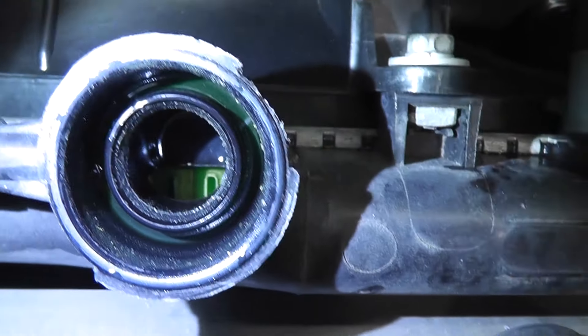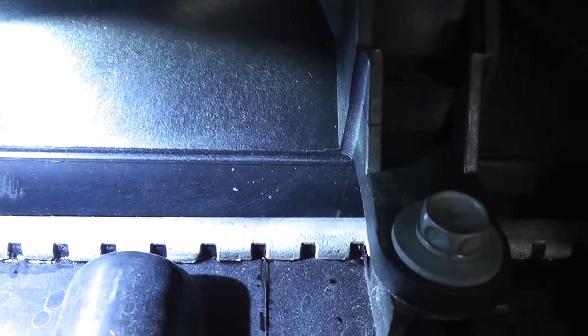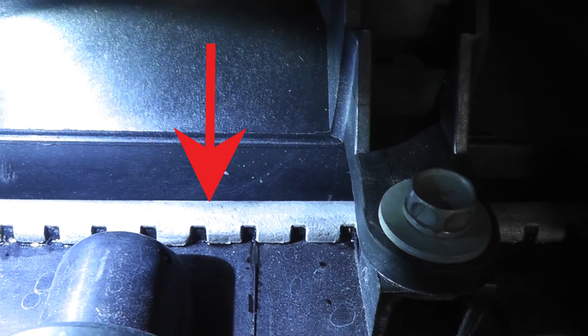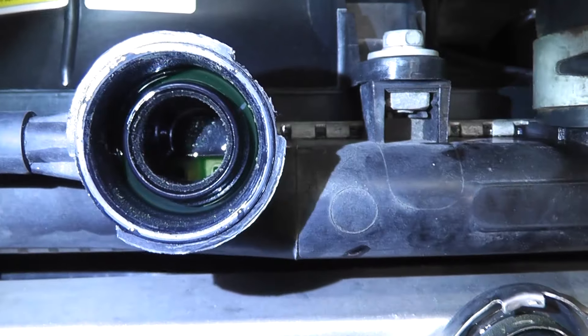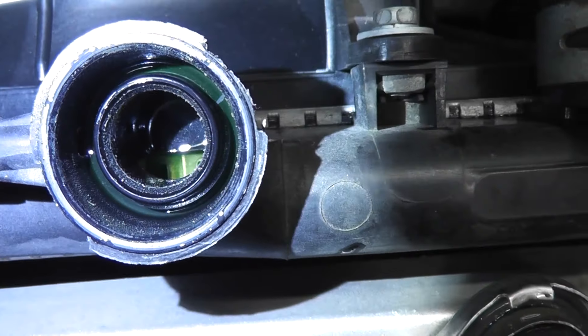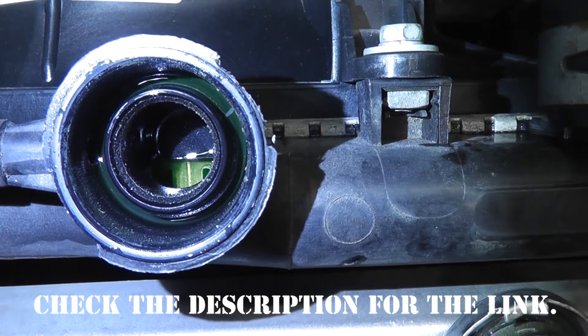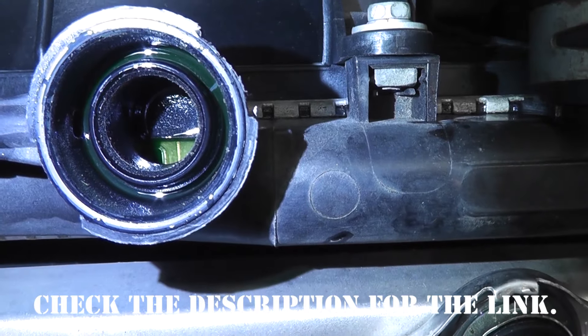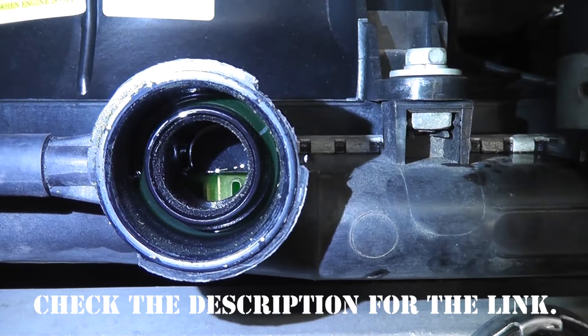As you can see, we really didn't lose that much coolant with this method — it's right at the level of the fins, which is right about at the level of where that aluminum piece is, and just below the level of the coolant hose we removed. So I'm just going to top off the radiator, and just to be safe I'll leave the cap off and bleed the system. I already have another video on how to do that. I'm doing it to be safe and to make sure that the radiator fans come on when the vehicle comes up to temperature.